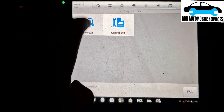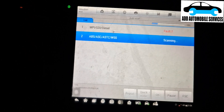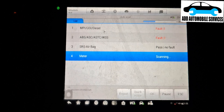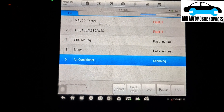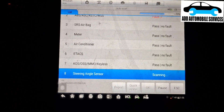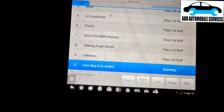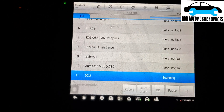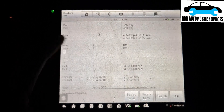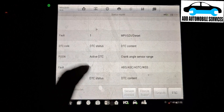The fault code is with the crank sensor. What it does is it reports that the check engine is on, so it makes all the other lights come on. Most modern vehicles behave that way — when they sense faults in the signal or in the engine control module, the ABS will turn on, and then the ABS will allow the lane keep assist, power steering, and other things to turn on. So with this one, ABS crank sensor range fault is on because of that.